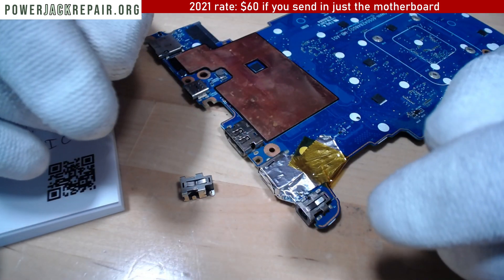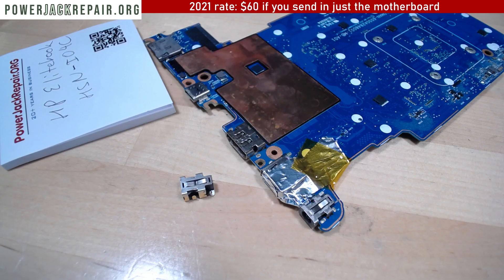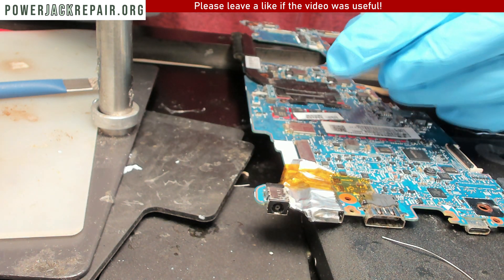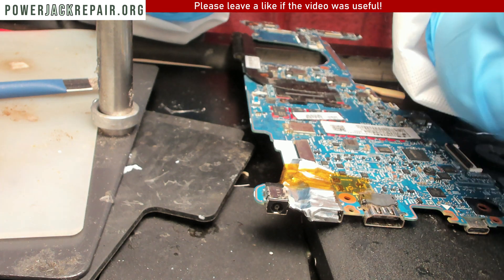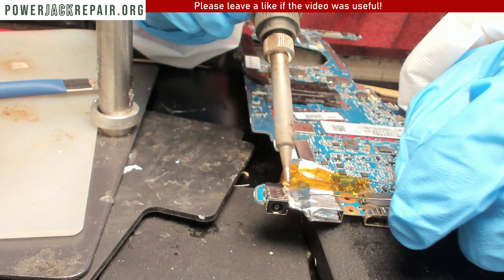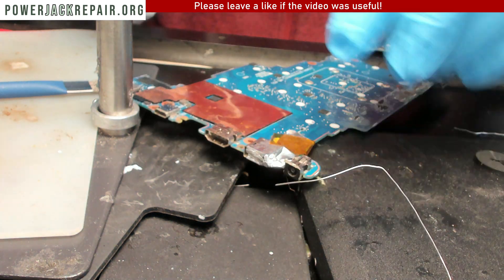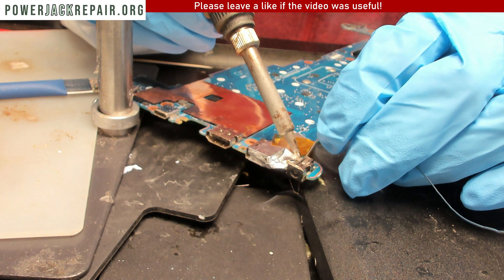This leg is for the center pin. Let me begin by desoldering this guy from the motherboard. In order to remove the connector properly we need to mix the old solder with the new solder — that way the whole thing is going to come apart much easier. We've added some flux and we're going to be soldering right there, adding more flux, more solder here and right there.